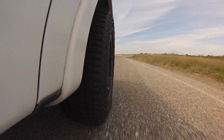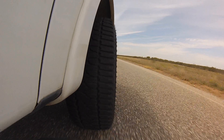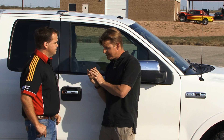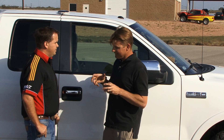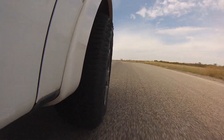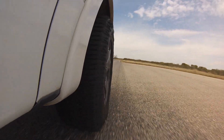Brad notes the Mickey Thompson tyre with PowerPly technology seemed to add so much value in that situation. Ryan confirms the tyre stood up very quickly and dampened quickly — up straight and kept going. Some of the other tyres not only overshot, sliding for a very long time, but when they released that energy the sidewall acted like a giant spring releasing a rubber band violently, requiring a lot of skill to bring it back under control.